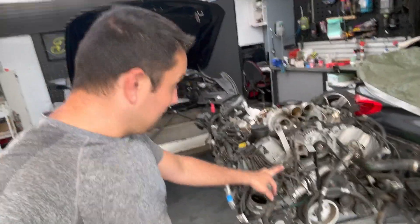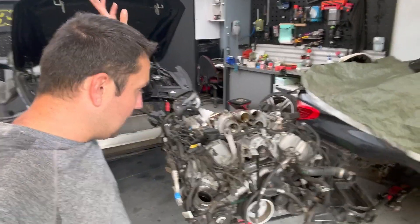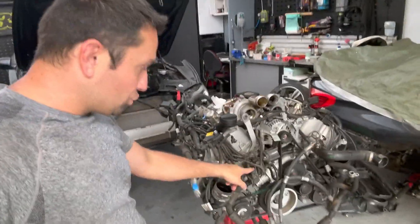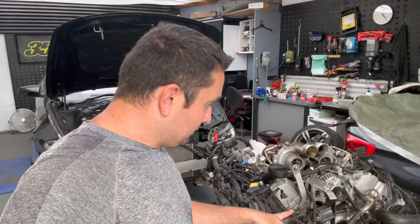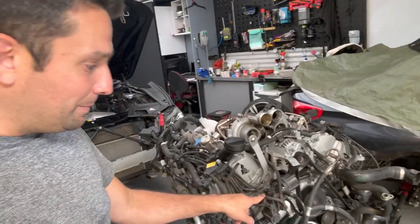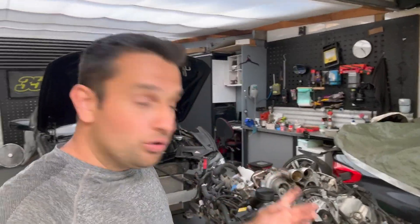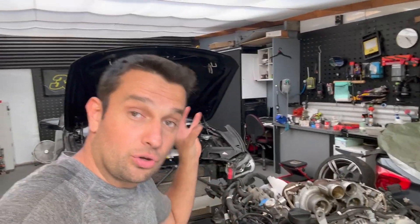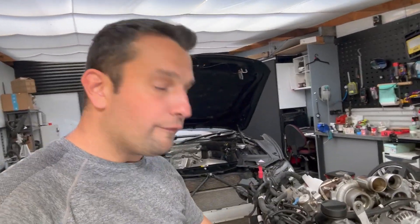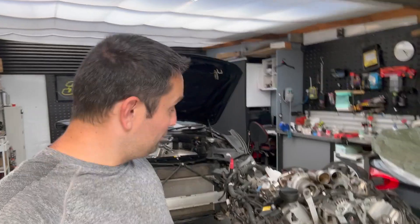So when putting this apart, remember to replace these hoses. They are very inexpensive — you can buy them from a hardware store or local auto enthusiast store. Here in Australia I paid about $25 for a meter of hose and replaced all the hoses on the X5M. Pretty plain and simple. The only critical thing is your ECU controls boost on one side while limiting it on the other, so you've got to be very careful not to mix them up.